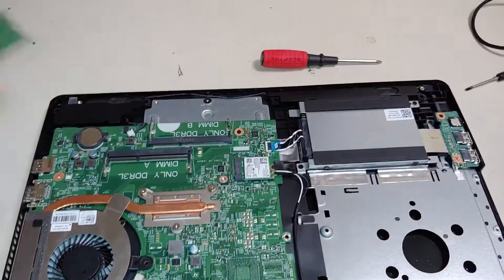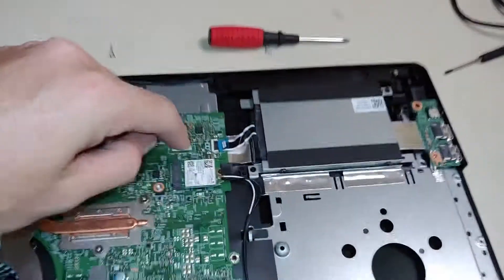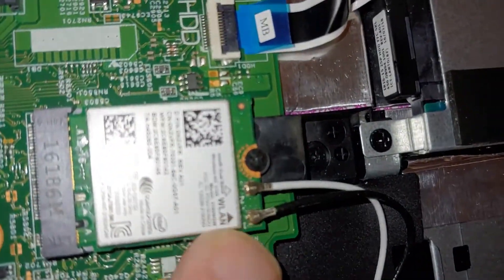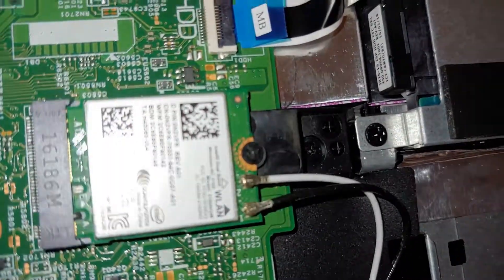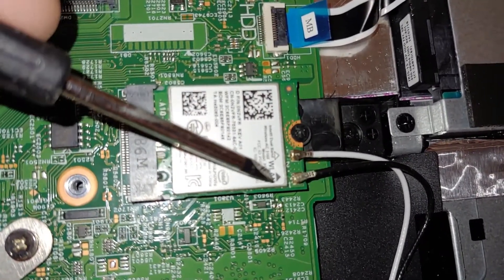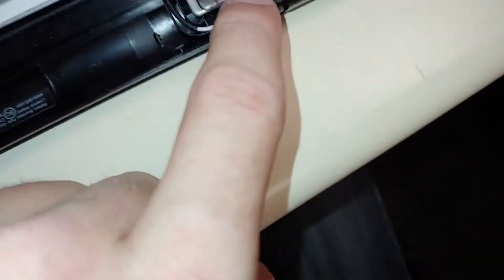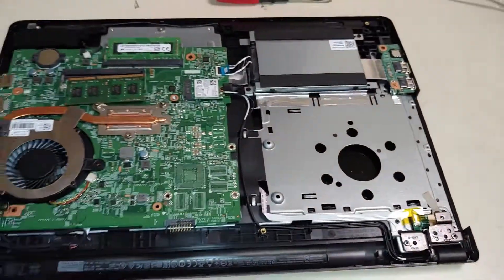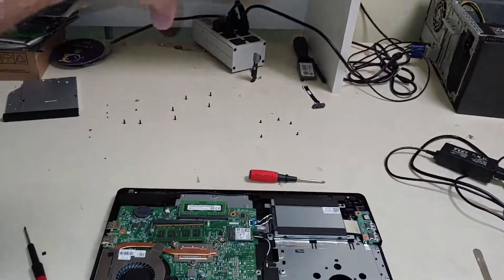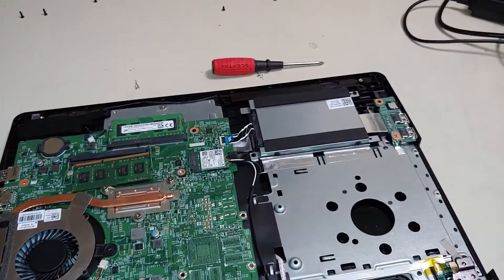In order to use both hands, while the camera was off I reversed the process: I put my plastic clip back in, my screw back in, my WiFi card back in, and the screw back in. Now if you look here, there is a black arrow and a white arrow — that is where the color-coordinated wires go. Your primary wire goes here, your secondary wire goes there. Interestingly, if you've never seen the inside of a laptop, all these wires trace down here and run to the top of the screen so that when the lid is open, those antennas are at the highest point to get the best signal range.